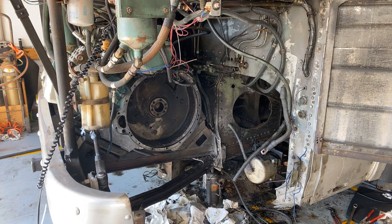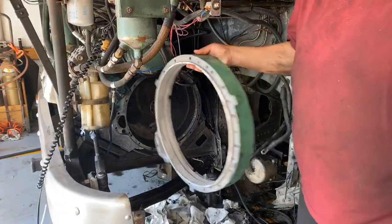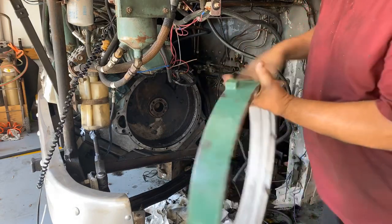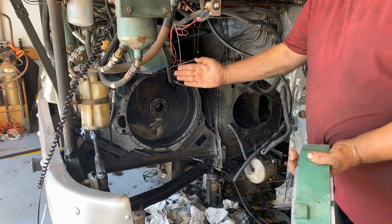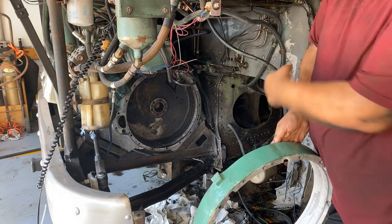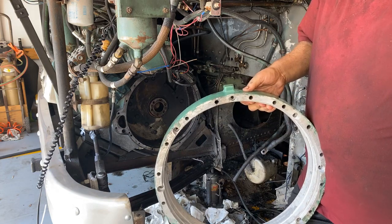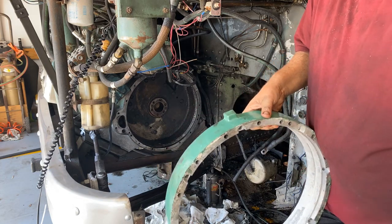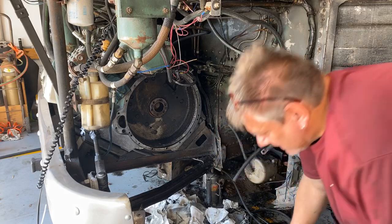Kelly's gonna be reading comments on the phone so if somebody has a question she might be able to ask it. This is what Kelly had to bring down to us — it's an adapter ring, about three inches wide, the same shape as the bell housing. We've got to do a little modification on it. What it does is bring the transmission out this way because it's longer at the V angle — it needs to clear that corner so it had to be brought out more. This ring is pretty rare; I just happened to have it in my private collection at home, saving it for the perfect job.